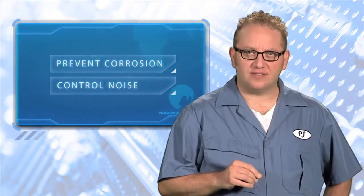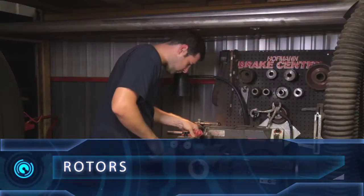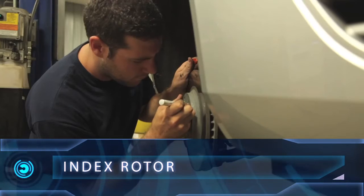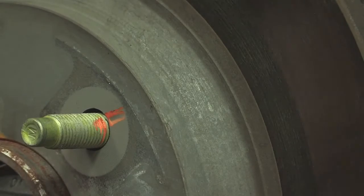Speaking of alleviating noise concerns, let's spend some time talking about rotors, which can reduce most noise-related problems when they are machined and installed properly. As you prepare to machine the rotors, be sure that the lathe is clean and sharp, and the adapters are clean and rust-free. Also, immediately after you remove the rotor, you'll want to clean it to minimize any run-out while machining. Before you remove the rotor, remember to index the exact original positioning so that it may be returned to its designated spot.